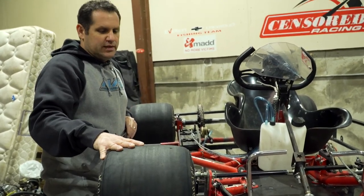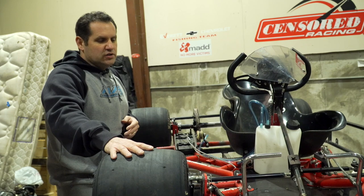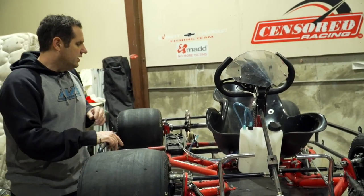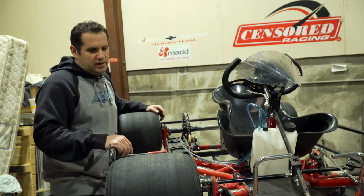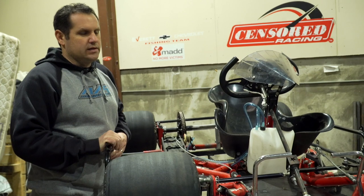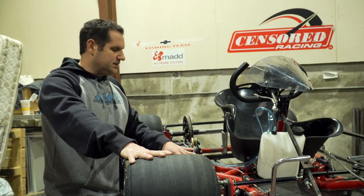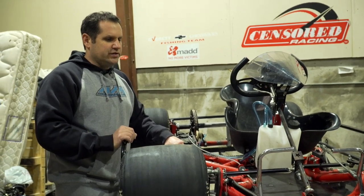It's always opinion and driver-based. Some drivers like more rear weight, some like more nose weight, some like more cross, some like less cross. The only way to know what you like is to try different things — that's how I figured out what I like through experience and racing. Toe and camber are also important on the front end. You don't want your camber off — it'll make you push if you don't have the full footprint of the tire down.